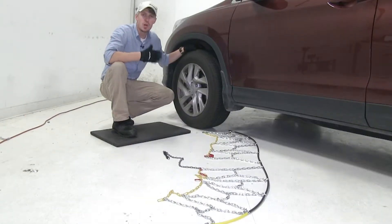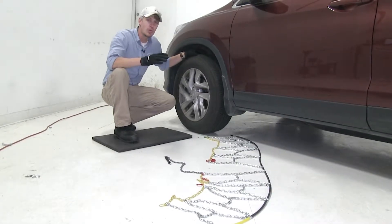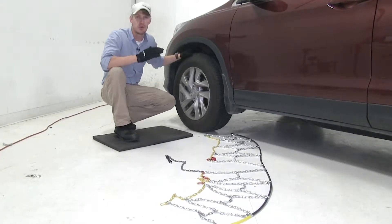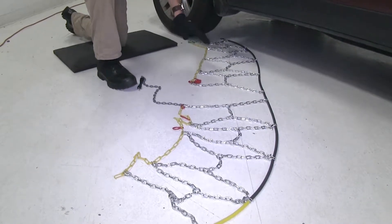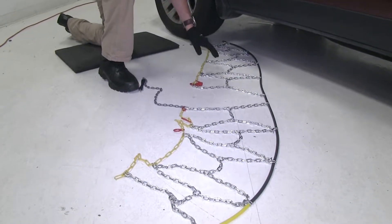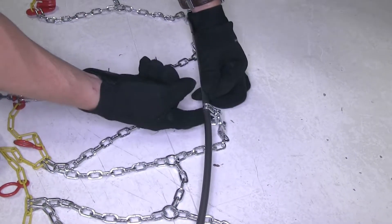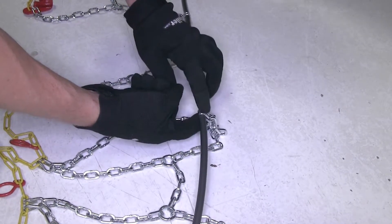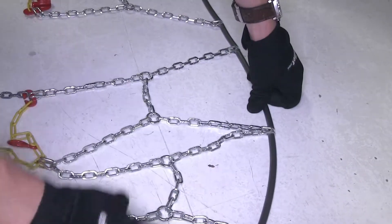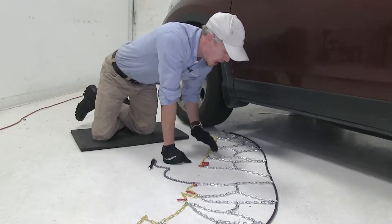You also get this nice carrying bag so you can stow it without making any mess in your vehicle. To get started, we're going to be putting tire chains on the front tires of our Honda CR-V. It is all-wheel drive, but it is mostly driven by the front axle. To begin our test fit, I've gone ahead and laid out the chain. It's a good idea to check to make sure there are no kinks, twists, or any tangles in it. You'll also want to be sure that the hooks here — the open side is going to be facing away from our tire. I've got it laid out in such a way that that's going to be so.